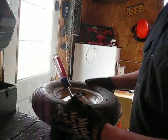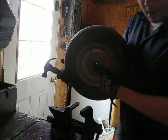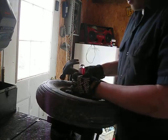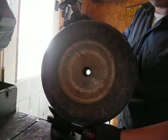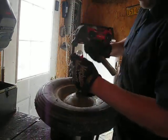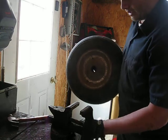First off, you will need to get the old bearings out and I usually just use a screwdriver and a hammer. What you do is set it over top of something like a vise so that you can hit the bottom bearing. If you set it over top, you should be able to just get right on it, give it a few wraps and it pops right out — just like that. Get the other one out. And ta-da! As you can see, there are no more bearings. Here is one and here is the other.